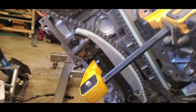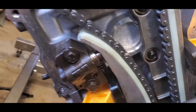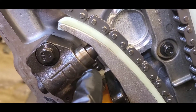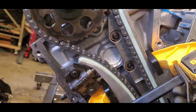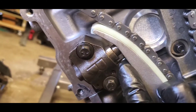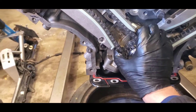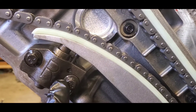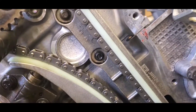One thing I like to do to ensure a nice tight chain during engine startup is take a wooden clamp, tighten it really good, make sure the ratchet is seated all the way up, then let the clamp go. You can see the ratchet is holding the highest position in place — your chain is nice and tight. As you build up oil pressure, oil will come in and push up on the piston to bring the ratchet up even further, keeping your chain even tighter.